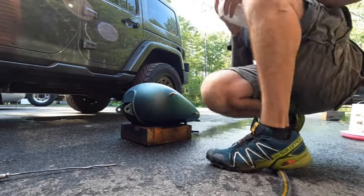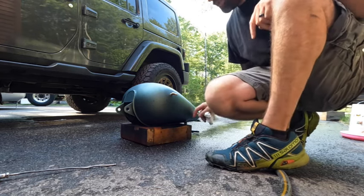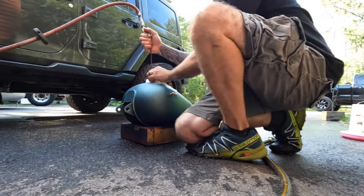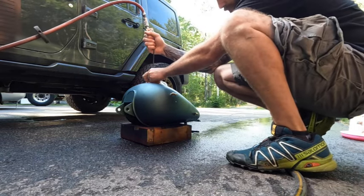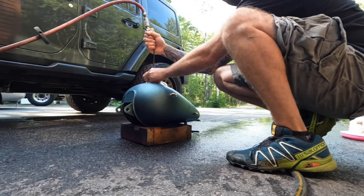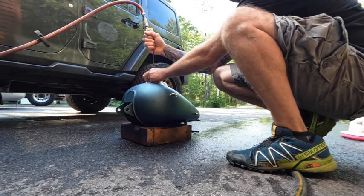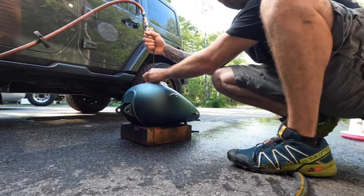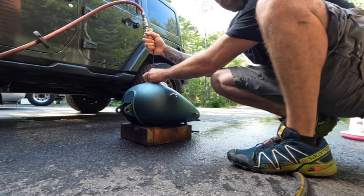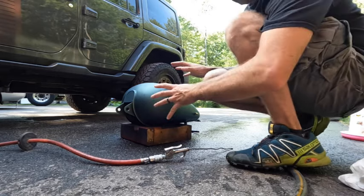The tank's been rinsed out several times now — running pure water through it. I've got all the water out of it and the vents open. I'm just going to put a little bit of light compressed air. The point is just to dry your tank with the vents and stuff open. You see a little bit of water splattering out — that's what you want. Get the majority of it out, then dry it with a hair dryer or heat gun. Don't put too much air in it. Put it in the sun, get it warm, let it dry out. Make sure after doing this that it's dry — it's key to have this dry before the next step.